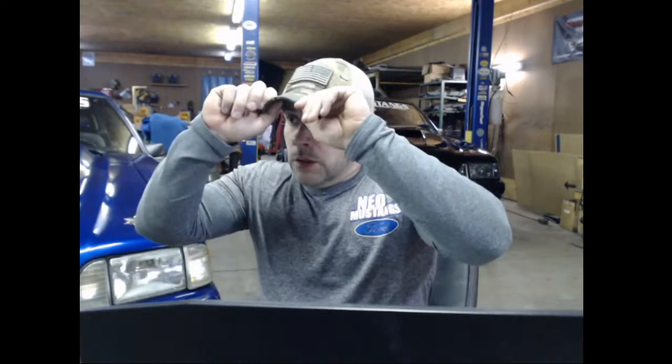I have a 95 Cobra, wanting to go turbo, but I heard the P heads have a pain in the butt manifold. Any experience? Yeah. My best bet, I do have a video of me putting P heads on a turbo car. Run a 90-degree boot spark plug and run the DEI with it. You might have to run a shorty plug in number 6, but I'm pretty sure, if it's sitting really close to the header, as long as you got a good DEI boot, it's not going to burn through. And just keep an eye on it.